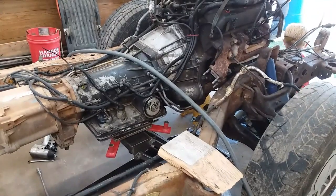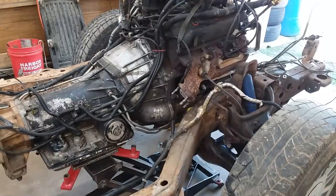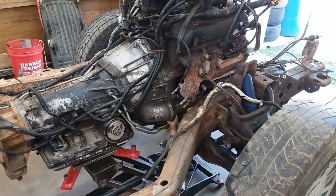We need to pull the starter out of here, so we're going to do the starter while we've got our block underneath the tail shaft. I like to take the starters out of these with the Y-pipe off, and the transmission jacked up in the air just as far as I can lift it. It just gives you an extra half inch or quarter inch to work, and I leave the cables hooked up to the starter — take the starter off of the rig and then take the cables off.